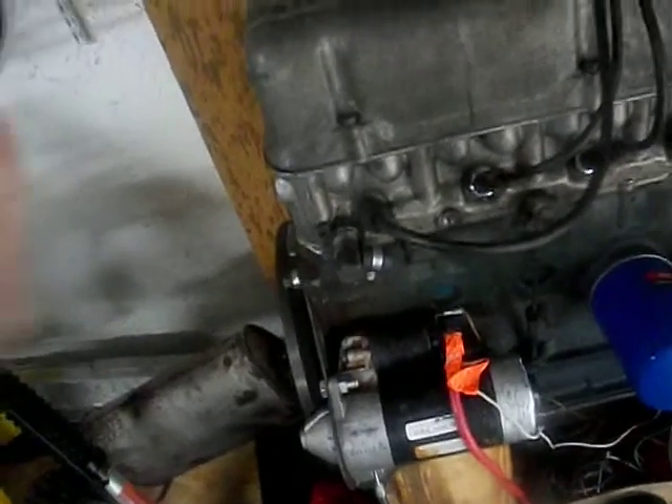When you drop the throttle off suddenly like that, you'll see it goes completely dark. That's because there's a fuel cut that takes place at certain RPMs. Now it's getting much less yellow. Let's make it darker in here so you can see better — close the garage door. There you go — nice blue. It's actually a yellowish-blue, kind of hard to see, but you've got a nice idle mixture going on right there. I'm right at 20 inches of vacuum.